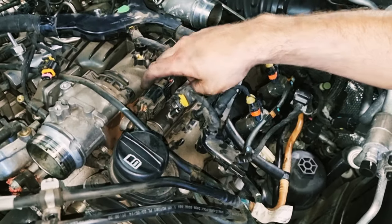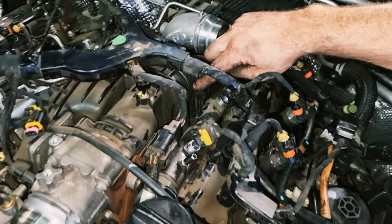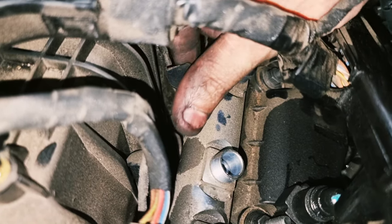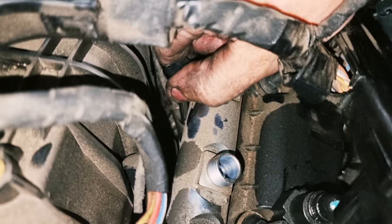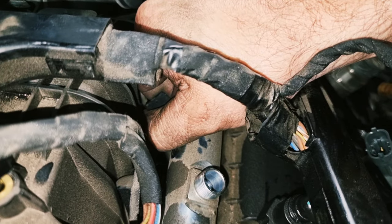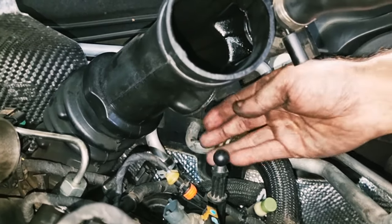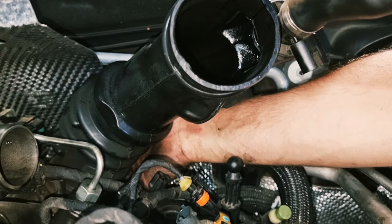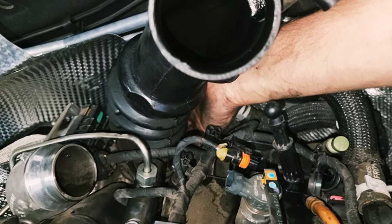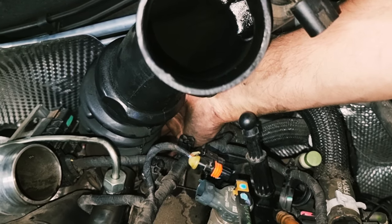And then the next problem is glow plugs. So your glow plugs are these, but they're easiest to grab with a pair of long nose pliers. See if it'll come now. Probably not. Now you want to take this flexi hose off, that's the intake hose for the turbo. There's a big hose clamp, usually the clamp is right on the back there, it's not much fun. I think from memory it's an 8 millimeter. If you can get a small quarter drive ratchet on that, that'll help you get that off.